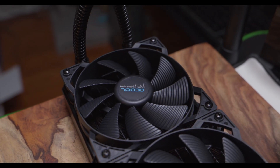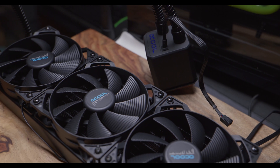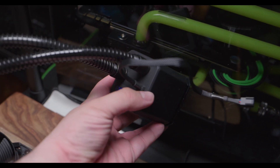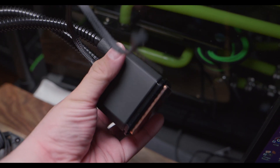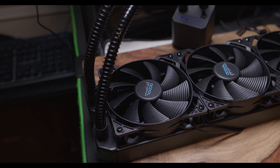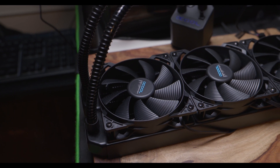I also wanted to try out the AlphaCool Ice Bear, the 360 millimeter AIO. This is kind of a different AIO — it has an integrated pump right where the CPU block goes, and it has expandable tubes. It's almost like doing a water loop but within an AIO, and you can install it pretty much like you would a Corsair AIO. Both solutions in terms of noise were pretty good. They're both running Be Quiet fans — the air cooler had 140 millimeter fans, and this one has 120 millimeter Be Quiet fans. Those fans have great static pressure, they're generally very quiet, and they push out a lot of performance. Upon installing this AIO, I got a little bit better performance, but it wasn't night and day. During the stress test, I was able to save around five degrees — so instead of going all the way to 85°C, I was topping out around 80°C.